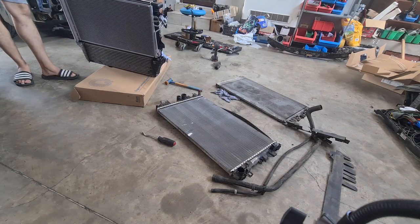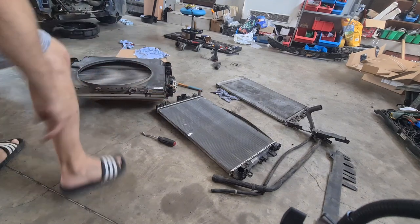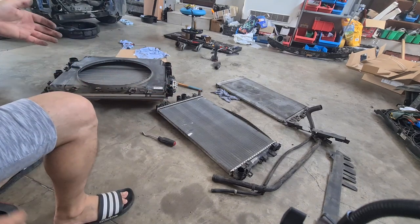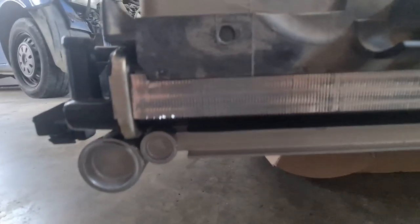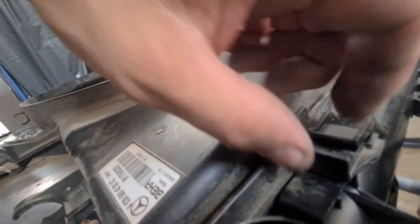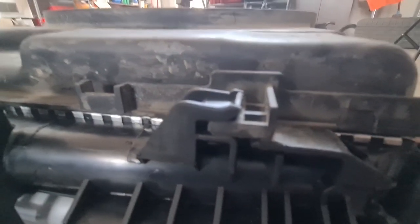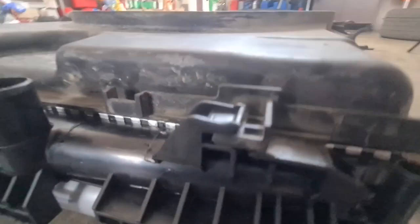Touching and bending. I don't know if you can see. I'll bring it closer. Here. See? It's already touching. And the clips are not over the hinge, if I might say so. This is on both sides. It needs to go lower, 3 to 4 millimeters, at least 3-4 millimeters.